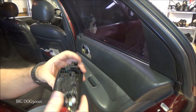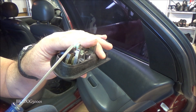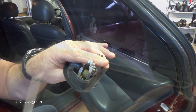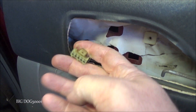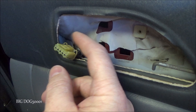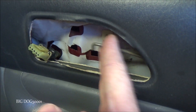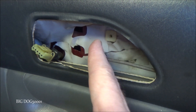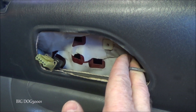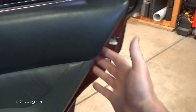You just got to pop that piece out — squeeze it and then take a screwdriver, press right there, and usually you can pop it up and over that rod, then just lift the rod out. You can see we don't have much room with this connector and this plastic is pretty stout, so be careful pulling it out. Something's definitely going wrong in there — we shouldn't be able to do that. It should just move a tiny bit with some spring pressure, so obviously our problem is over here.